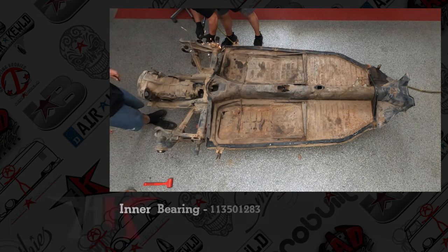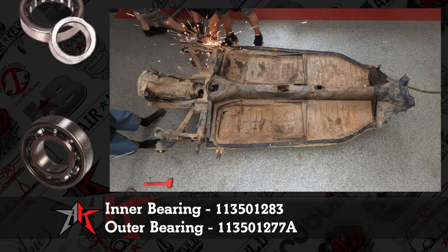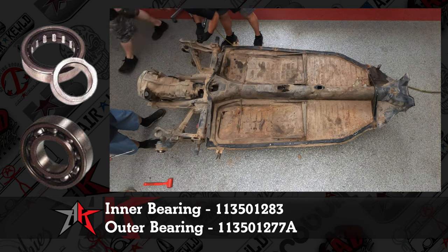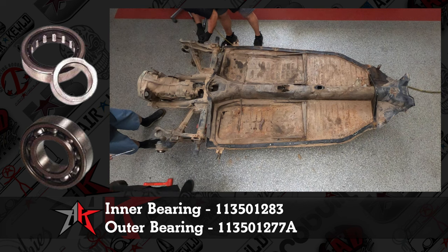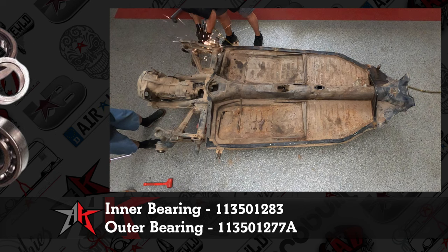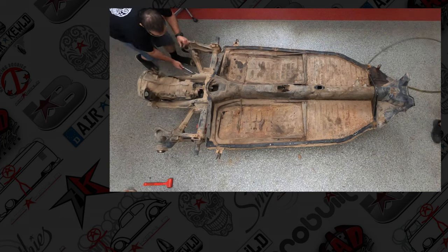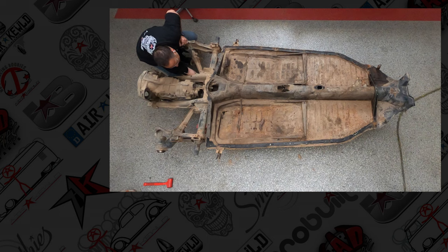You can spin the original bearings in your hand, if you feel like a grit or a grain or has a high-pitched sound, then obviously replace them. I'll put the part numbers for those bearings up here on the screen. Wolfsburg West, again, get used to it. Good guys over there, they'll take care of you. But all the spacers, you're just going to check for flatness and grooves and trueness, and just do your due diligence. Just don't assume that everything's good.